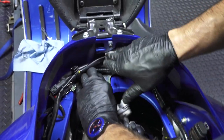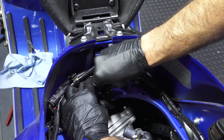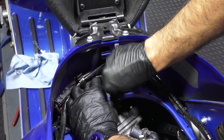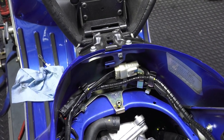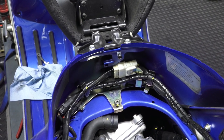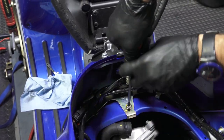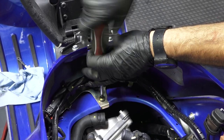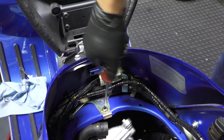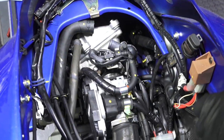And you can see there's a screw hole right there. And we'll get the single screw. Let me see if I can reach it. There we go. Let me get a Torx driver. T25. All right, so T30 Torx driver. And make sure it goes straight down into the frame. This little metal clamp right there just closes down on the cabling. I put the one screw back in place.